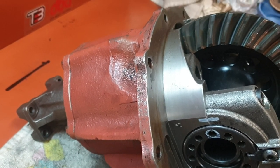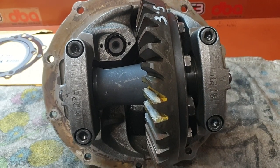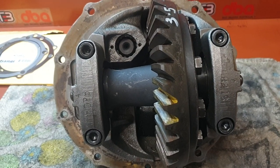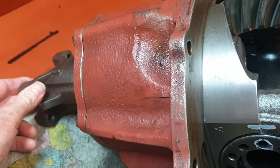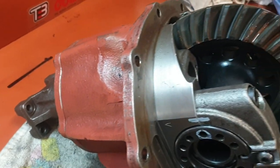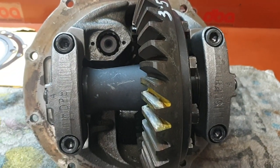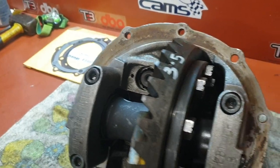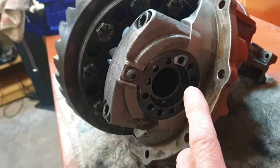It felt really nice — you can feel it if you've worked with stuff like that, especially with trailer bearings or any tapered bearings. You can feel whether they're too tight or too loose, and before I even pulled it apart it feels exactly the same, even though I've put a little bit more tension on it. I kept all the bearings and obviously didn't have to change anything over except for the crown wheel, and it's all come together beautifully.